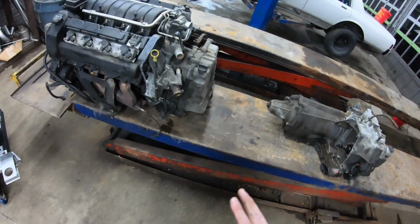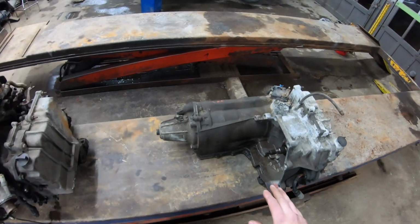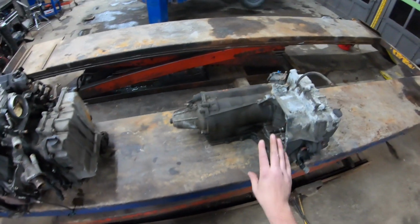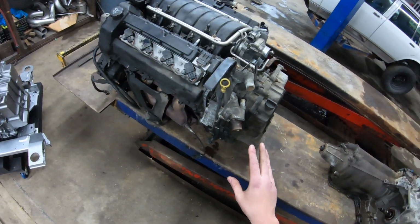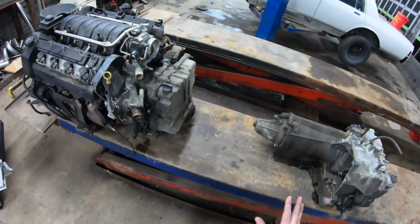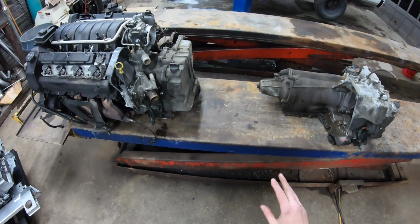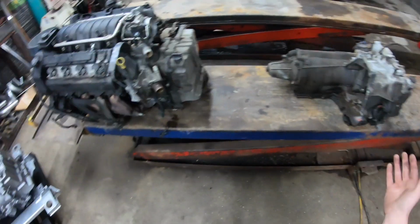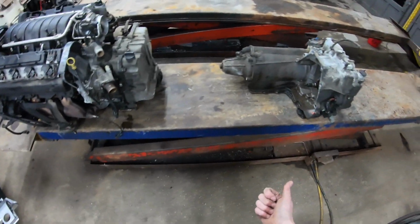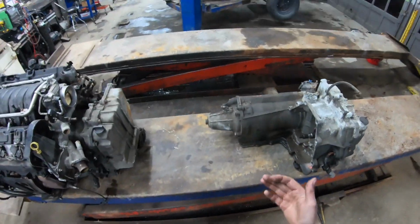Now, the other major difference between these two is the manifold pressure switch in the lower valve body. The manifold pressure switch is actuated by the shift lever, and in the first generation, it's 3 position. The newer stuff is a 2 position. That's important for the electronic control of the transmission. I'm gonna go into more details about that later, but essentially that's the only difference between the 2 generations. Everything else is the same. You can get the same gear ratios. All the internal components are the same. The major difference is the electronics.